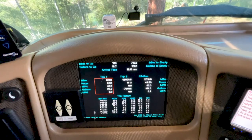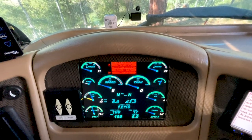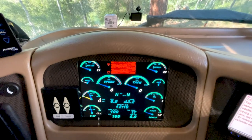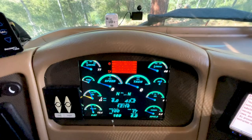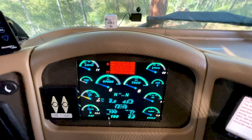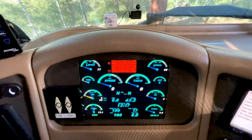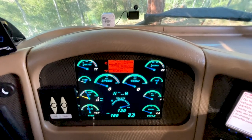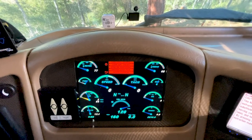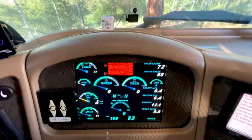I can also monitor our trips. Usually the way I drive is in this format where I have water temperature and transmission temperature on top, then speed and tachometer. I try to keep my RPMs up going up grades. You can set this up to calculate your trip and it'll show you miles per gallon, arrival time, and probably most importantly how much fuel is required for the trip. Right now I have 120 gallons on board — we hold 150 — and on this particular trip it said it needed about 17 gallons.